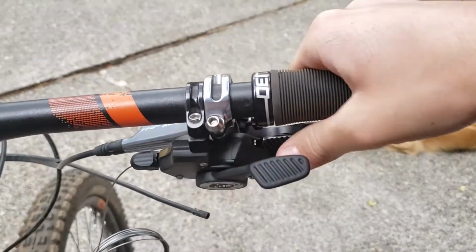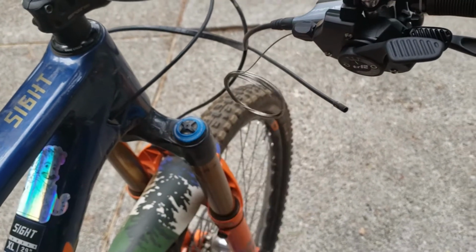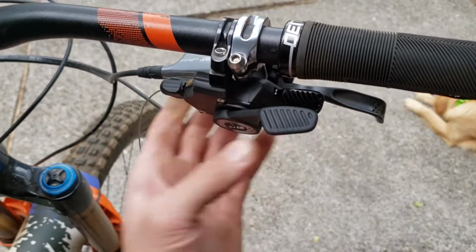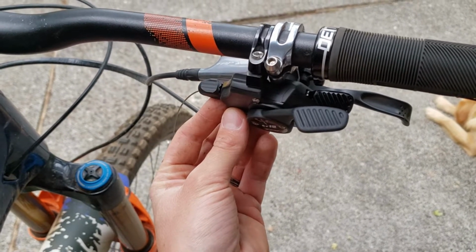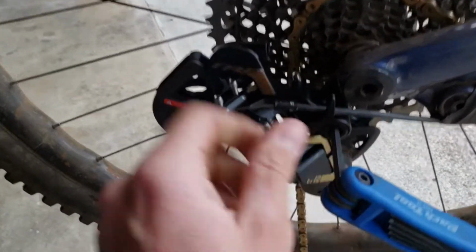That's kind of where my hand goes. Play around with that a little bit. And now to plug the shift line into my old housing. Oh yeah, pro tip, you want to make sure that it's totally bottomed out there, or else when you set your shift tension, it is going to be incorrect, and you'll have to do it all over again and feel like a chump.